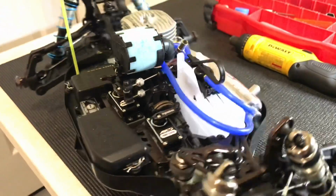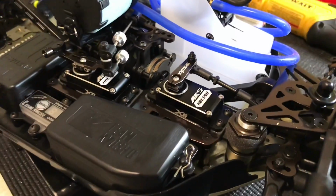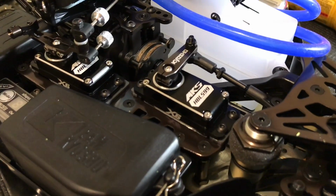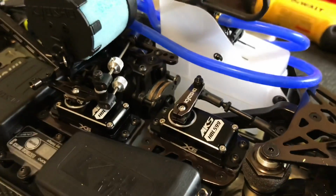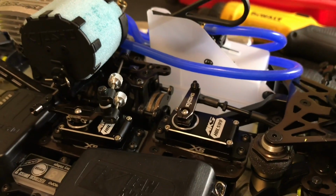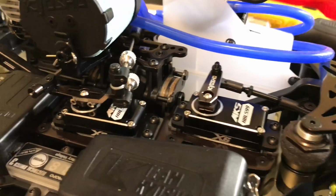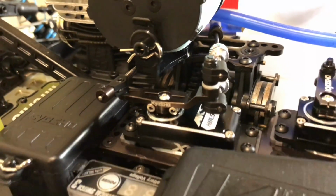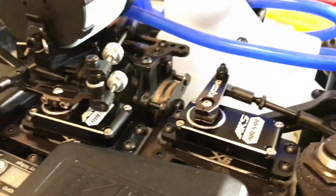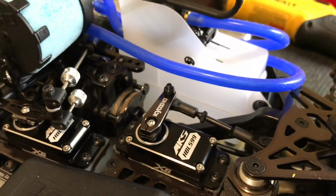As for everything else, same old for me. Rocking MKS servos, the HBL 599s for throttle and steering. I ended up going with the same as I did on my TKI4. These are two brand new servos that I picked up for the new build. Also running the Kyosho aluminum servo horns for throttle and steering. These are the Futaba tooth ones. MKS is 25 tooth spline.